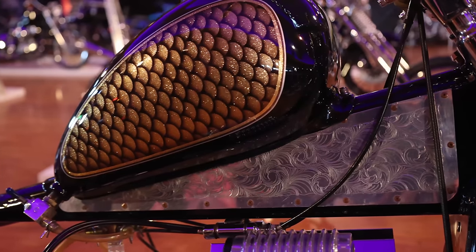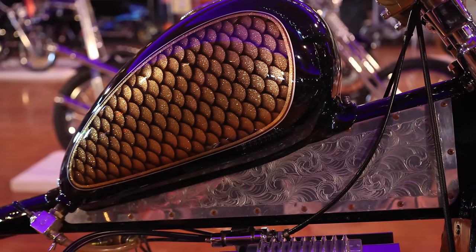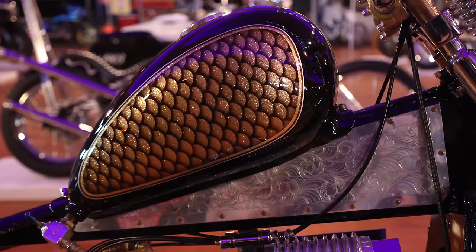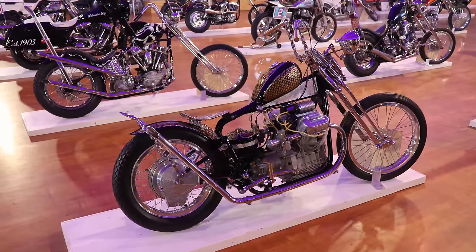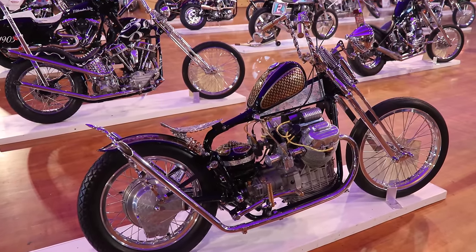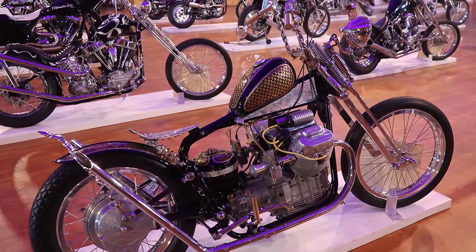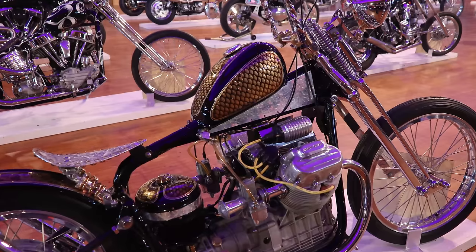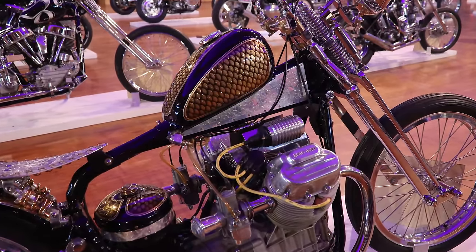I bought a 1972 850 Eldorado. It was a bagger, and I turned it into a chopper. There's a lot of custom Moto Guzzis, but I haven't seen one like mine, maybe years ago. It's got a Springer front end and everything. Most of them leave the stock style front end and make a bobber or something out of it. I took the stock frame, which was a loop frame, cut the loop off, and made it rigid.